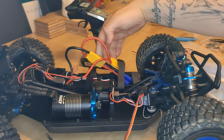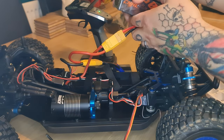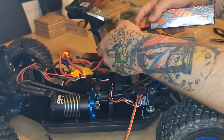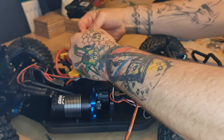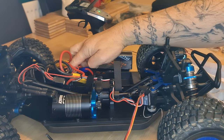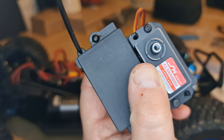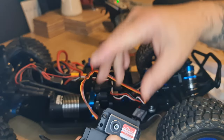What I'll do, just to make sure I've got it correct, is grab two 3S batteries and plug them into the car now. This is something you need to do anyway — make sure your servo is centered so you can actually line up your servo horn with no issues. Grab my transmitter, make sure that's turned on so the car doesn't shoot off. Just going to plug in now. I just want to make sure that the servo is centered before putting the servo horn on. That should be nice and quick actually.